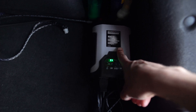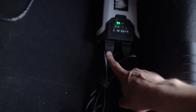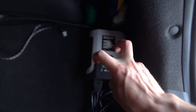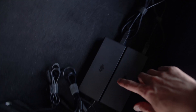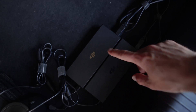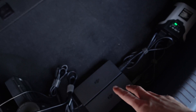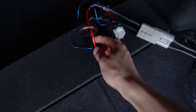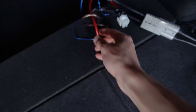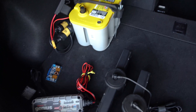So this is a run-of-the-mill 500 watt inverter that takes DC to your regular AC plug. It's an Eliminator, but 500 watts is what you need to run two DJI chargers because these are about 200 watts apiece when they're working. And then obviously you're running a lot of juice, so you'll want to be considerate of what type of wire you're using. Definitely use something thick. This is 8 gauge, this is 6 gauge here. You probably wouldn't want to go any smaller than 8 for running 400 watts, which is about 40 amps — that's quite a bit of power to be drawing.